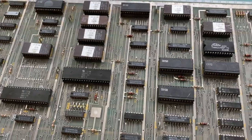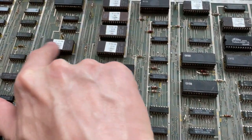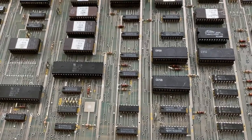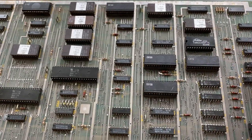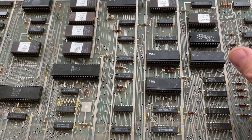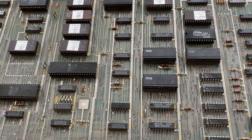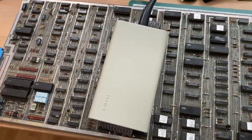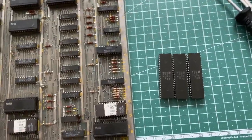What we could do next is take out the Fluke and put it into the position of the primary CPU. With the Fluke, we can actually try to talk to the RAM and see what happens - if the RAM can be contacted, if it can be read, if it can be written. That would be very interesting to see. I hooked up the Fluke and removed all three CPUs from the board.